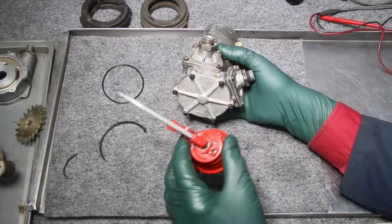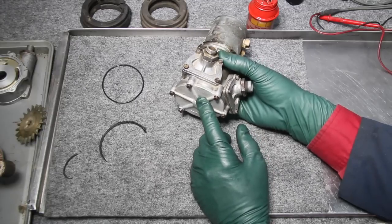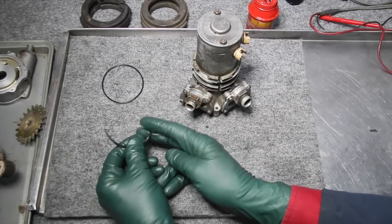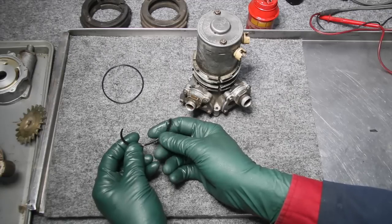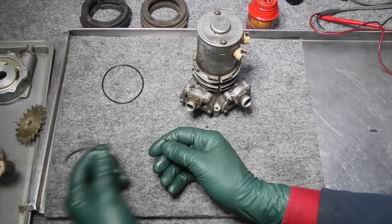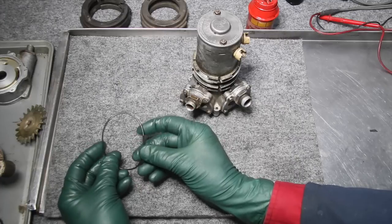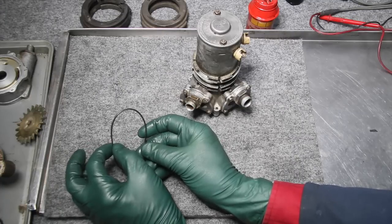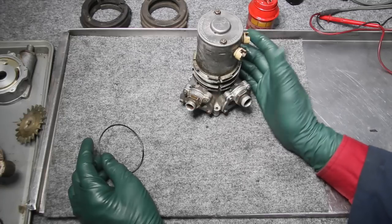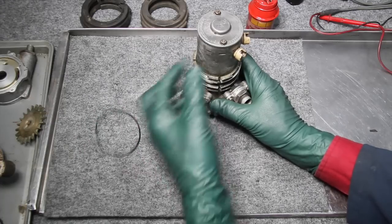Lubricate the O-ring. Now let's talk a little bit about that O-ring. Look at the one I pulled out — it wasn't even an O-ring. Somebody had just put in a whole bunch of RTV silicone and it was actually working; the pump was not leaking. Good on him for a successful repair, but I don't really recommend that. When I went to install the O-ring from our short kit, it's the right diameter but it's a little too thick. So I had to get another O-ring out of my stock — I happened to have an old OE O-ring that fit this pump. I'll put a link in the show more below if and when I'm able to source these O-rings for the long pump.